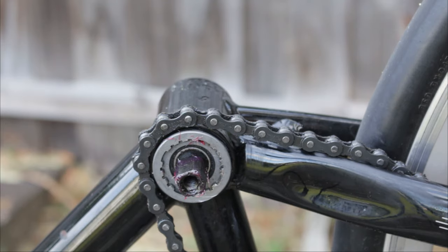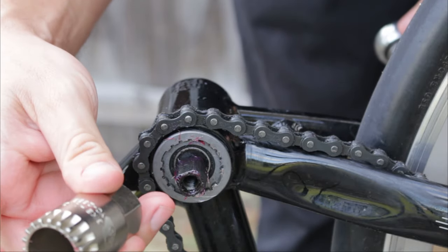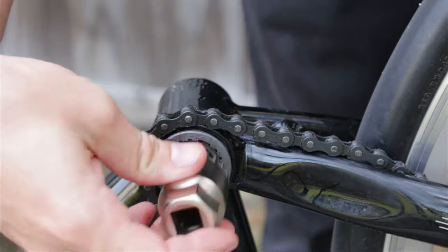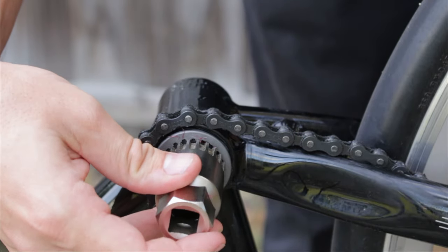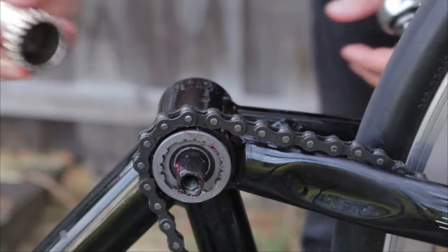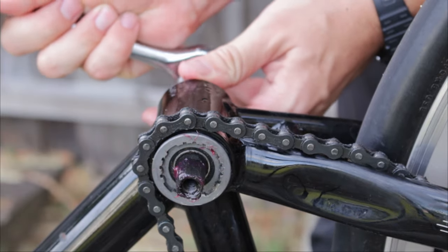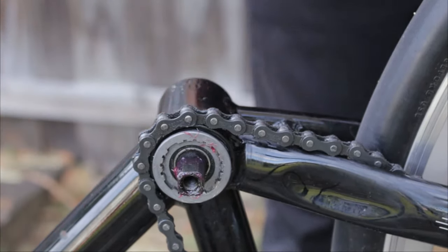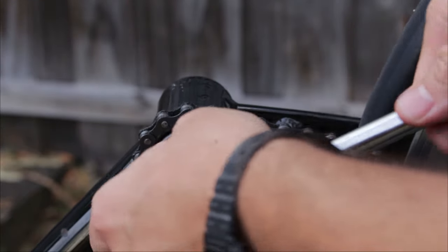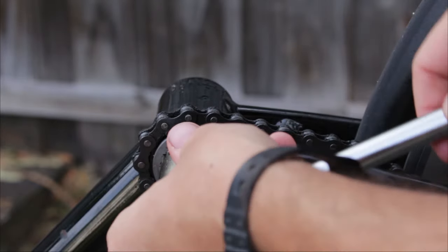Okay I'm back and it's the next day. I did go ahead and grab the right tool — I happen to have one luckily. It's a BikeHand YC-26BB. To tell you the truth I already did stick this on and I was shocked to see what I found: the entire bottom bracket is loose, and it's not just this side — both sides. So I'm going to try to tighten these down and see if that helps the problem overall. Alright, that's pretty snug. Let's go ahead and do this side. I wasn't sure how that worked but when I tightened that one it seems to have pulled and tightened this one too somehow.